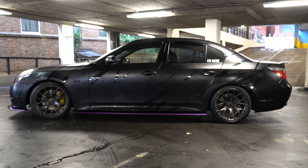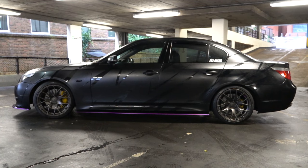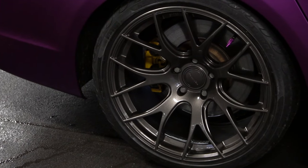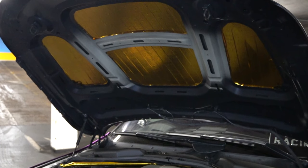And how does it put power on the ground? It's not too bad, actually. On a day like today, horrendous. Very wet, very windy. It's fairly wide wheels, they have 275s in the rear, so it's not too bad. On a dry day, first and second, you can't boot it. Got the third, fourth, and fifth to go. And you're saying open diff too? Open diff, yeah. We'd love to get an LSD for it, but they're just so expensive. Yeah, fair play. Needs must anyway.